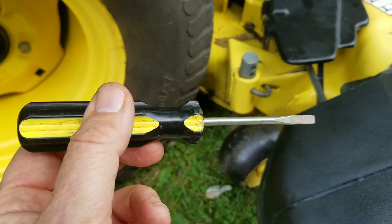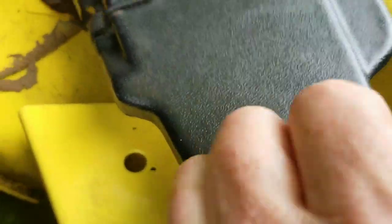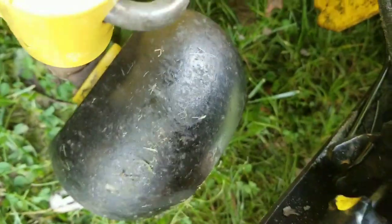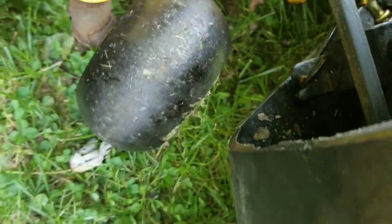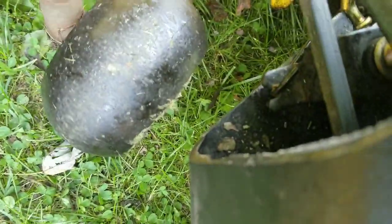It's the right length and it does the job, because what one is trying to do here is to move. This is now on and tensioned. You can see that, but one of those cogs down there has to be, and this is somewhat counterintuitive, to create slack, that bottom cog has to be moved backwards, not forwards, but backwards. And the only way to do that is to get the screwdriver on there and lever it back until it locks into position. And if you can see that, you get behind there and lever it back until the cog swings around. Underneath this is the lower pulley inside the Powerflow here. It will lock in place when you move it back.